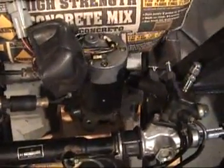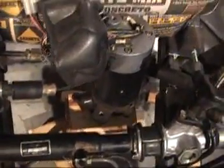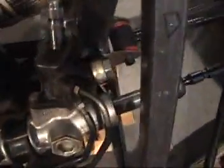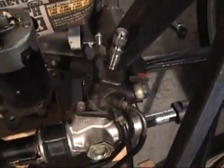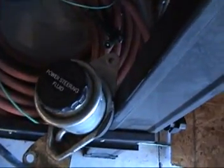It's got an electric power steering pump on this car, so it's a very simple system. This is basically a pump with a switcher at the top and just a tube that goes around and drives into the steering rack to power the steering. There's a return line that comes off of there and goes back across to this little guy right here, which is just my power steering reservoir.